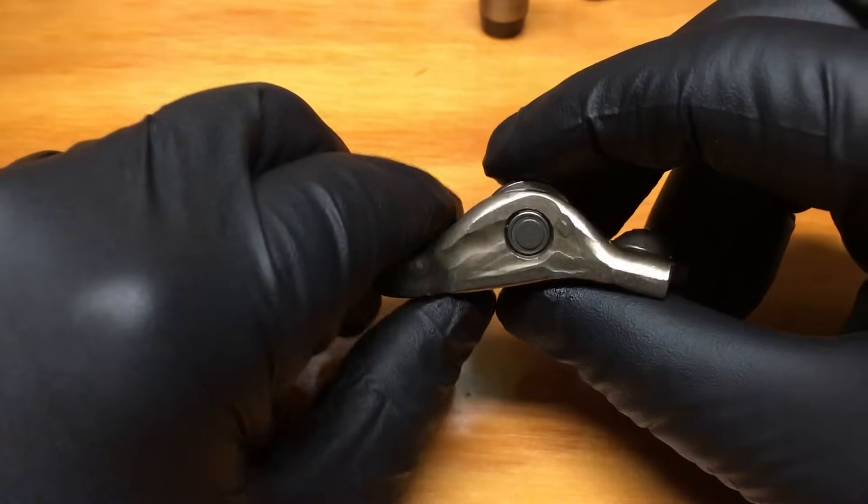Hopefully this gives you a good understanding of what to look for when inspecting your valve train on the 5.4 liter 3-valve engine. I didn't provide a sound bite because the noise can sound different with each type of failure: a collapsed lash adjuster typically only makes noise on startup, while failing roller followers cause noise all the time. I also had a compression-type noise from exhaust valve failures where pressure bled through when the intake valve opened. Hopefully this helps you fix your Ford yourself — see you next time.